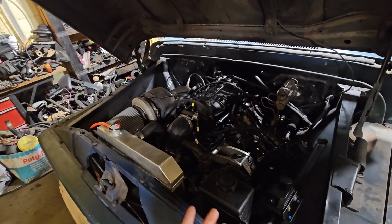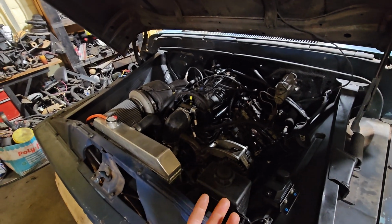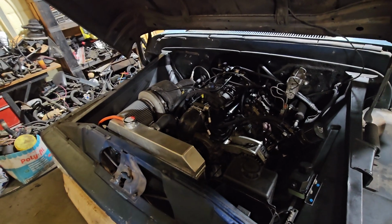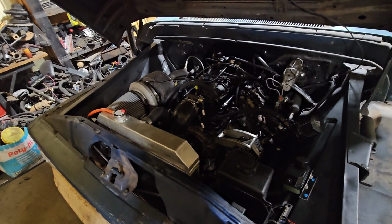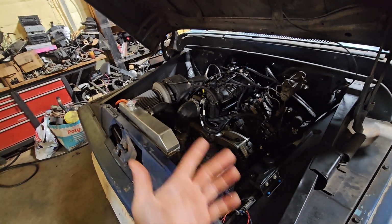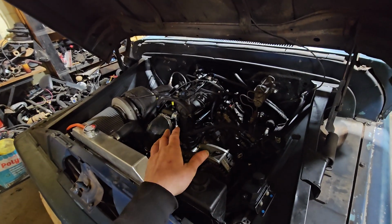The springs that they give you for the wastegate don't really have a whole lot of different options. It comes with 5 springs, and 3 of them are 6-pound springs. So I don't know why. I wanted like an 8-pound spring, but there was one that was like 6.5 or something. So that's what I did.